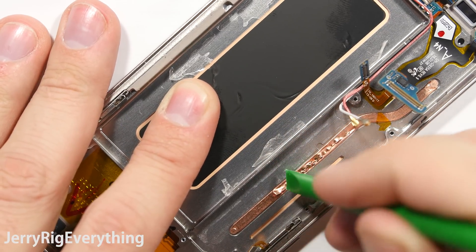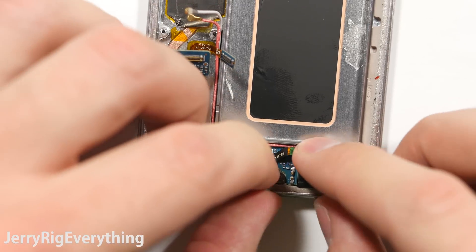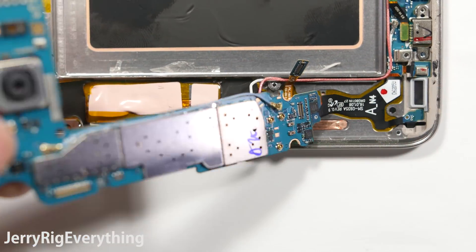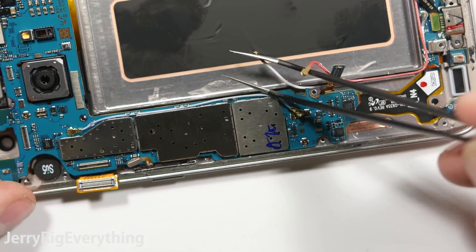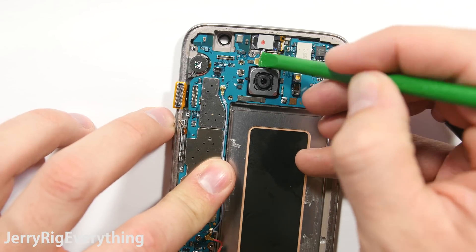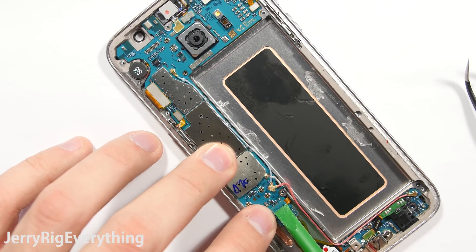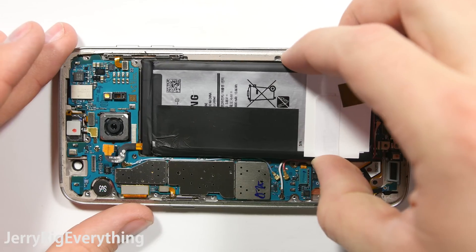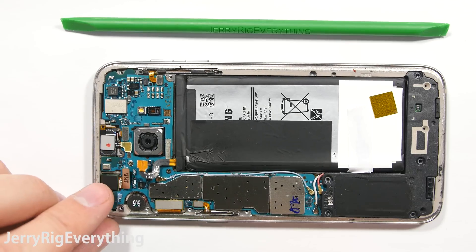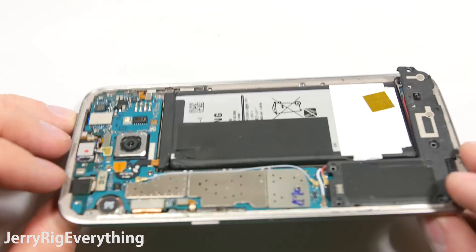Hit that subscribe button if you've enjoyed this video so far. I'm going to put the tape back on with the little foam heat transfer bits and then start putting the phone back together. I'm going to put the headphone jack back in by the charging port and then snap the charging port ribbon cable back into the bottom of the motherboard. Set the motherboard back into place making sure to get all the wires out from underneath it — that includes the two up by the earpiece, the volume rockers, and the power button connector. I'm going to snap all those back into place. Same thing with the fingerprint scanner and all three signal wires. Battery goes into place, and before I connect that I want to make sure everything is plugged in. I'm going to get the charging port screwed back into place with the loudspeaker set down on top of that. The 5 megapixel front camera goes in and then I can plug the battery in and turn on the phone to test the screen.